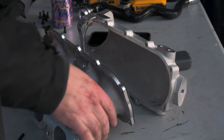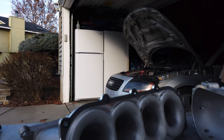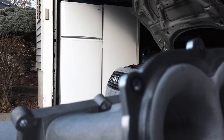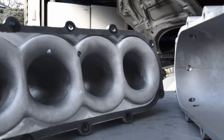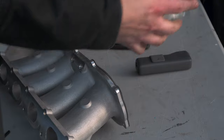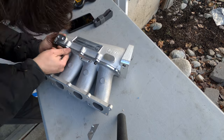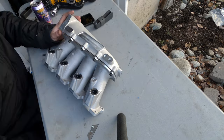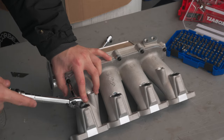This thing is built to be rebuildable, so it comes with its own gasket, and it's really easy to work with. It's also incredibly satisfying to look at. If you're wondering if you absolutely need a new tune to run something like this, the answer is it depends. If you're increasing the diameter of the throttle body, absolutely. In my case right now, I'm using the stock throttle body, so the car really won't behave that much differently. There's just going to be slightly less back pressure after the throttle body. At this point, this is just entirely for future-proofing.